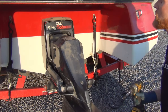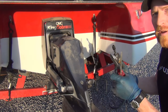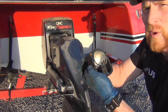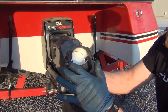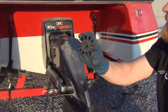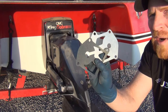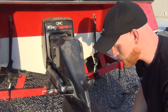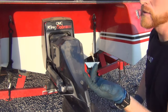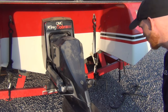This doesn't require a whole lot of tools. I've pretty much just got a three-eighths drive socket, a screwdriver, a pair of snips, and a kit. The kit's the important part. You're going to want to have this metal housing, the o-ring — I've already got that sealed in place, you want to do that ahead of time — the impeller, that's the main event, a wear plate, and a wear plate gasket. I also like to have a razor blade to get the old gasket off, then either some sandpaper or a steel wool to get the rest of the gasket off.